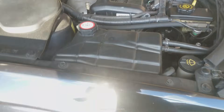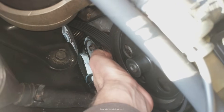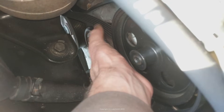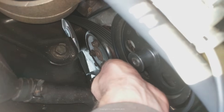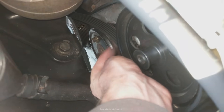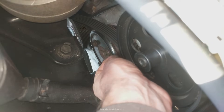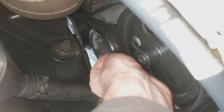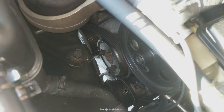That would cause a squeal. I had already replaced a few of the pulleys recently, so for me it's just a case of identifying which of the remaining ones is the likely suspect. And here this water pump pulley is obviously gone — it spins too freely. It's worse than when I checked it when I replaced the belt. I can't reproduce the knocking by hand like this; it obviously has to be spun faster or maybe it needs to have the belt tension on it. But it definitely needs replacing so I'll do it anyway.